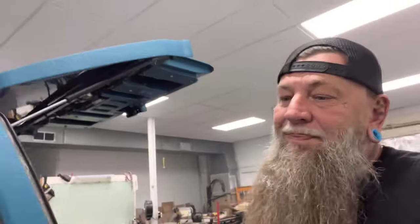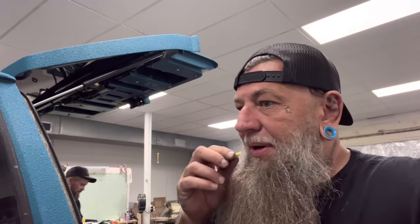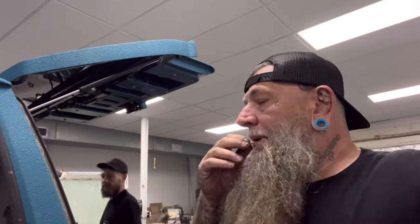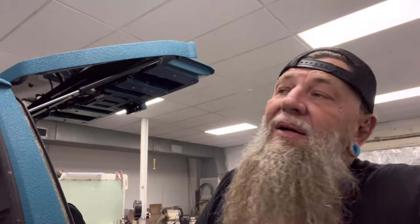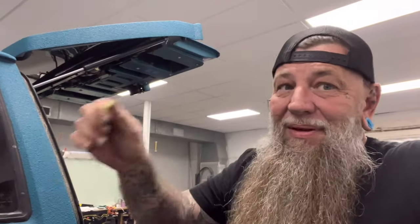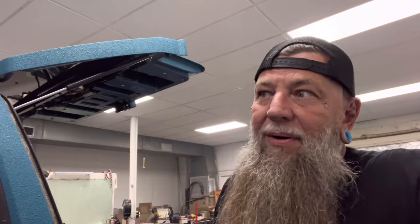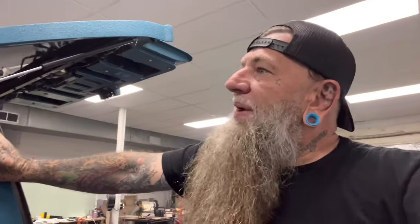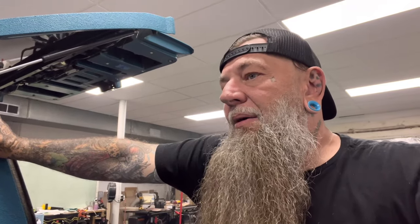What I'm doing here — I put a new alarm in. It's the same brand alarm I always run, so really all I had to do is put a new brain in. At Ruckus Show years ago, Deb had my fat boy regulator wired up where the volt meter was wired to the battery in the back, and I told her to bump the voltage up to like 16.2. But she kept turning the knob — it wasn't going higher because it wasn't reading what the alternators were putting out, it was reading battery. Long story short, 24 volts blew everything. It actually melted the door lock actuators. So here I am redoing all that.